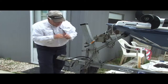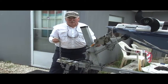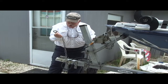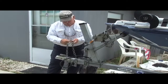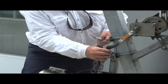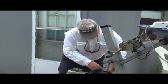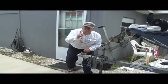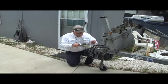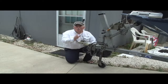The other thing is your safety chains. Your safety chains are a very important part of safety on your trailer. Make sure that you use a good, strong chain with a nice, strong hook on it to hook to the frame of the truck and the trailer hitch area. Make sure that you have at least one good chain, but I would recommend two. With the pin in, the lock down, and the two chains on, you're ready for the highway.